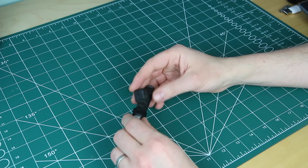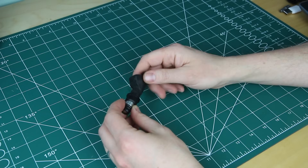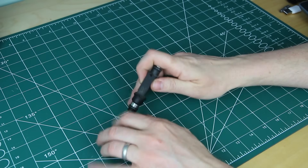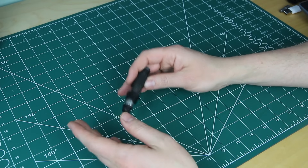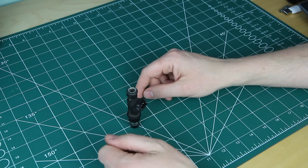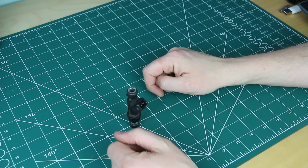Once you know the injector type, you also need to know the flow rate because the ECU needs that to compute how long to keep them open. If you're lucky, you can find it online from the part code. If not, you're going to have to test. I always recommend testing anyway because that way you know they all work and flow the same amount of fuel — so when your car won't start you're not second-guessing the injectors.